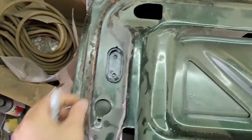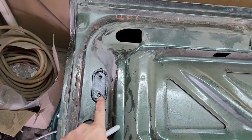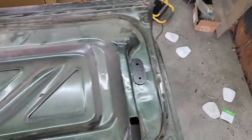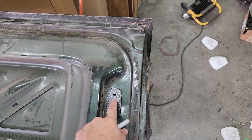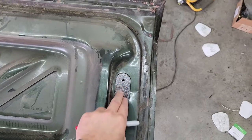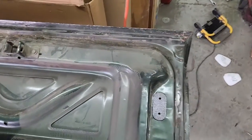Well, they come with paper templates and stuff like that, and I was like, you know, you can do something better. So what I did was 3D design some templates which will double as a kind of a backing plate. They still probably need a little bit more work — they need to be a little bit taller so they can slide under. But this centers the holes where you can mark them. I even made a cap for them so once you're done, you can cap them off and kind of close off the hole. I have a feeling the bolts will be too long, which is why I got holes in the cap as well — that way the bolts can slide through and you can put that rubber grommet on the top of them.